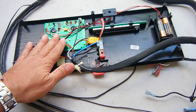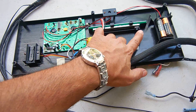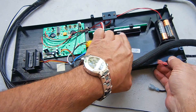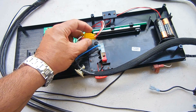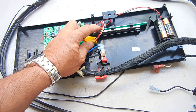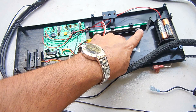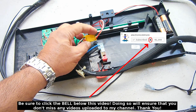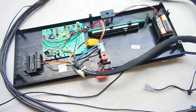The power comes up, loops back, and goes all the way down to that speed control board. Really not much to go wrong over here unless the display goes bad, in which case you'd have to change out this board. Over here is a 10K slide potentiometer — easy to check. Do a resistance reading between the black and the red — it should give you the full 10K rating. If you put it a quarter of the way, between the white and the black should give you around 2500 ohms, and between the white and the red should be around 7500 ohms.